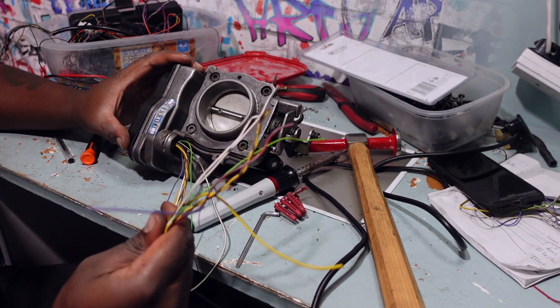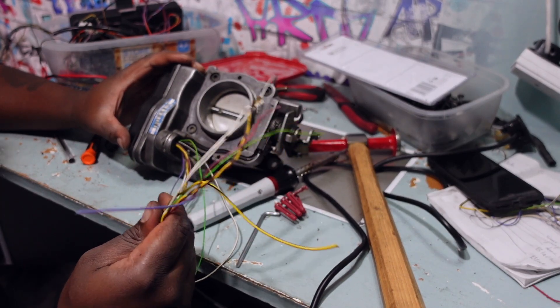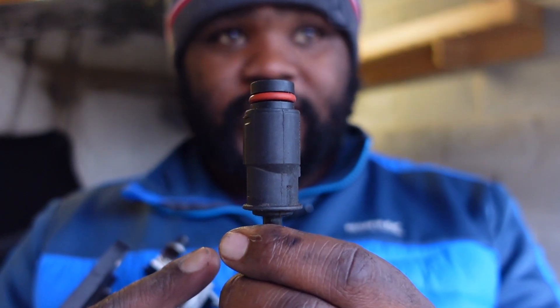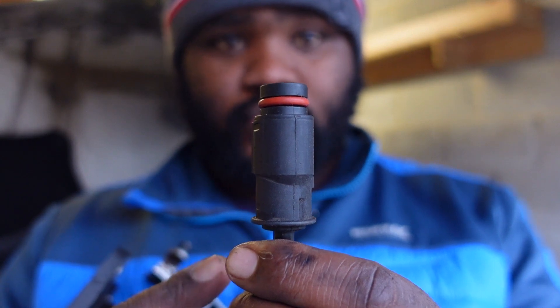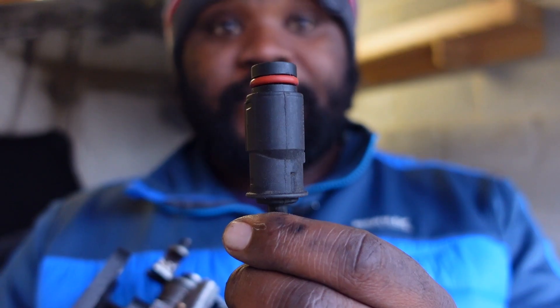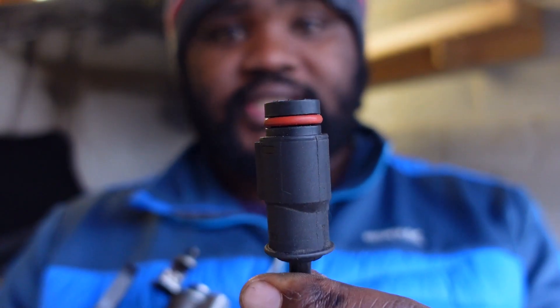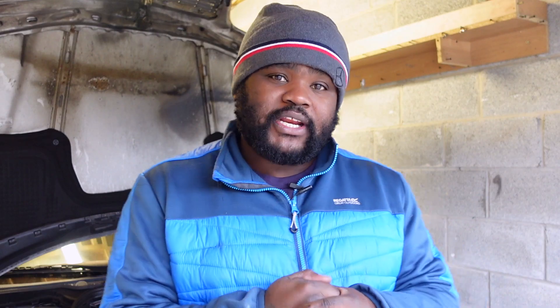All I have to do now is find a different connector and connect it to the other wires back into the harness. I don't necessarily need to use the same Mercedes-type connection. This is the 8-pin connector I'm talking about — the female side is irreparable, but I'm just going to replace it with a different one. It doesn't matter as long as there's a connection and the resistance is the same — there's no trouble whatsoever. Anyways, I won't waste any more time. Please like, share, and subscribe to the channel. Peace, I'm out.